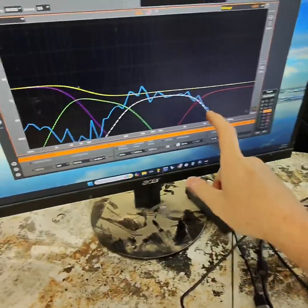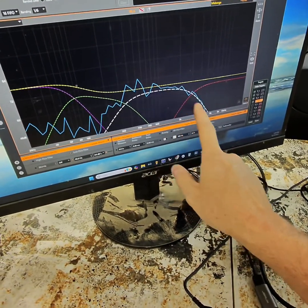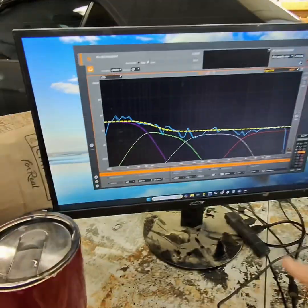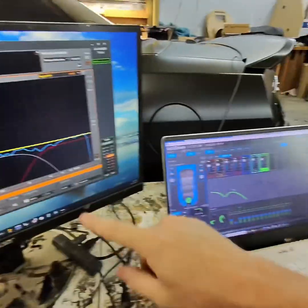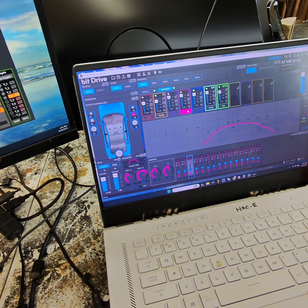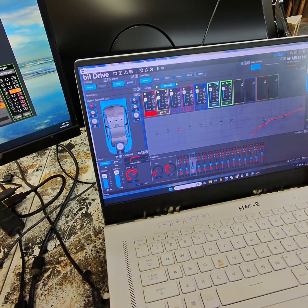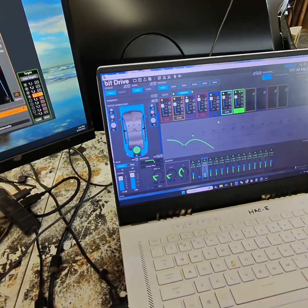All right, so now Mo's tuning the mid. So he's got the driver front mid-range. And he's been lining this up here, so now he's got to EQ this. So we pulled a little bit down over here, and he's adjusting it. All right, so we got our target curve. We had some cancellations in the car. We got everything EQ'd. That's our sub, driver, passenger door, driver door, mid-range, tweeter, other tweeter. Now we got to sit in the car, center everything up, make sure we got a nice center image, and of course listen to it.